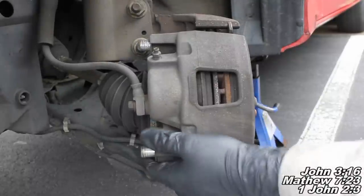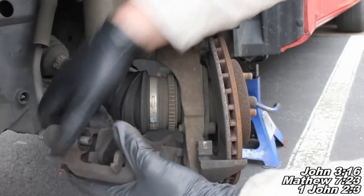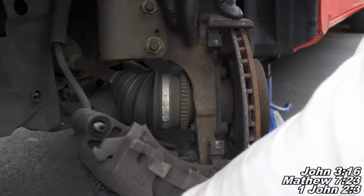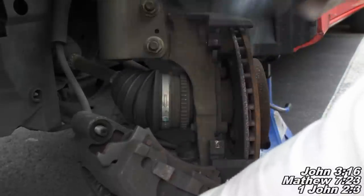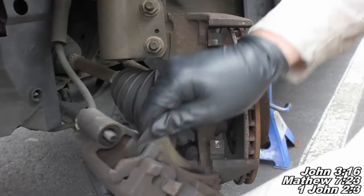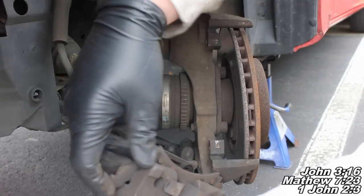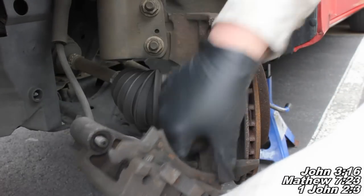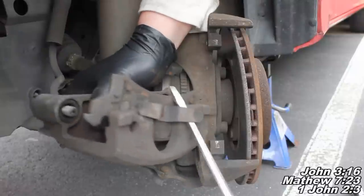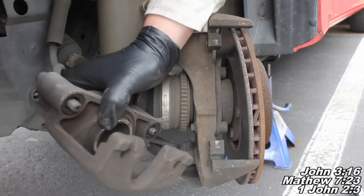Once we get both those caliper bolts off, I'll just go ahead and pull the caliper right off. We've got this rotor here, and wow — you don't even have to take a bracket off. The bracket is actually built into this knuckle right here; the caliper itself serves as a bracket, so that's pretty cool. We're going to pull these pads off — that one's just kind of sprung in there, and then this one we're going to take a flathead screwdriver and kind of pry off. And there we go — that's how you take the brake pads off.